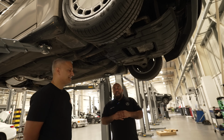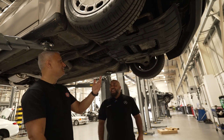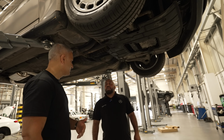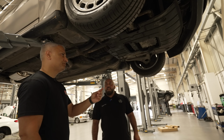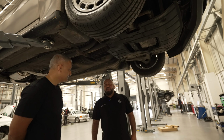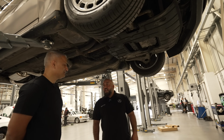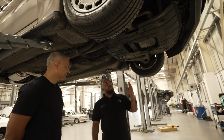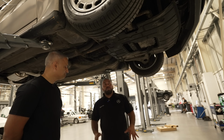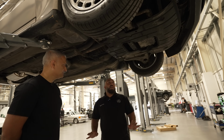It's a good thing, actually, because I did have that change last year. Okay. I had it flushed last year, but obviously it was the original rad, so internally that rad would have been just horrible and rusty as well. Yeah. My concern was that I was throwing all that gunk back through the engine. To be honest, it wasn't that bad. Okay. For the age of the vehicle, I thought it was quite good. So we've flushed it all out, put nice new coolant in, run it up, bled it all out, so it's running nice and sweet. Driven it as well, road tested it, and it drives nice.